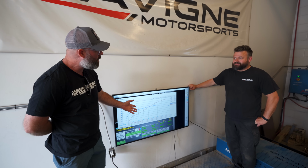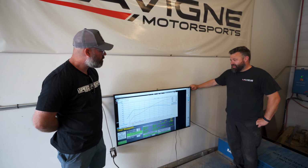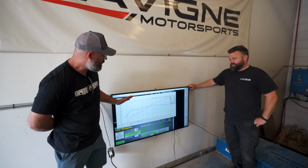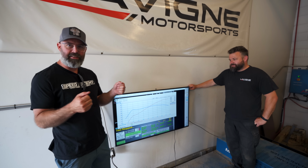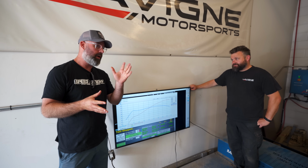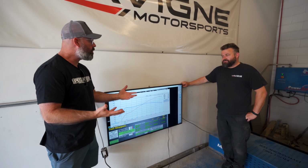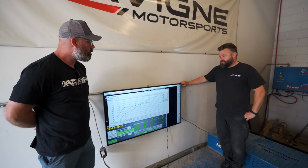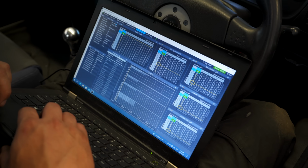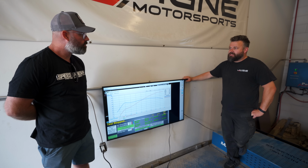It was 21 pounds, is that right? 21 and a half for the most part, and then we just crept up deep into the 22s at the top to kind of keep it climbing so it doesn't feel like it's starting to hit a wall. Yep. You showed us earlier when you were working on the whole knock setup how you were able to basically tune the knock tables. Yeah, so we set up all the knock thresholds. At low boost, you figure out what your engine noise is, and then from there you create your knock threshold.